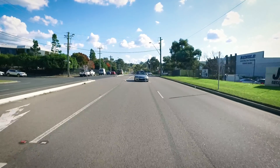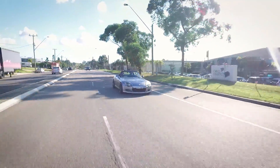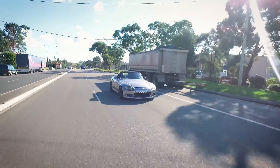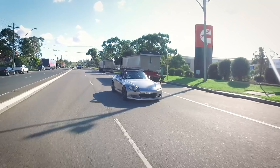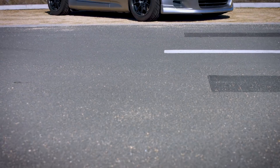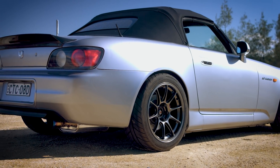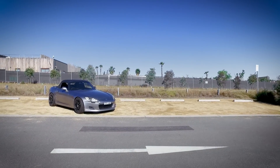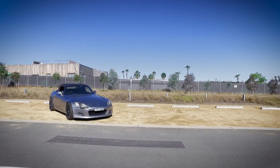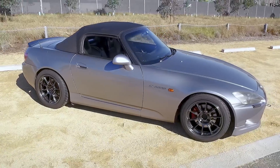You might even end up making money selling off your F-Series engine and putting a K-Series in it. It's an unusual thing to think. It's not difficult to see why people would K-swap Miatas, Corollas, Datsuns, and most Hondas. A K-Series engine simply outperforms all of the other engines originally used in those cars. But the motor Honda stuffed in the S2000 is a different story. The F20C is a two-litre, four-cylinder, inline-four, famous for its 9000 RPM redline. It also uses Honda's famous VTEC variable cam control system, which actuates between about 5500 RPM and 6000 RPM depending on engine operating conditions. Having driven a few Honda S2000s over the years, I can confirm they're no slouch. So, why would anyone want to K-swap an S2000?